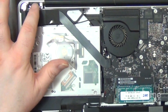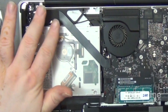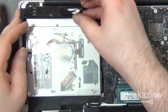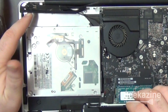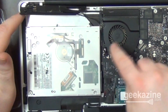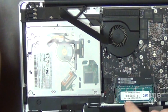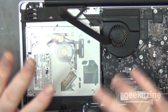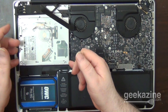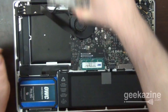In some models, the two screws are going to be right here. There was a third screw in some cases, but in this case we had two screws right here. Once I popped those two screws up, this piece became flexible. Inside there were three screws — one right here, one right here, one right here — which I had to pull up, and those are the ones sitting in this bin. Once that happened, everything was ready to come right up. I just took my finger and brought the DVD drive out.